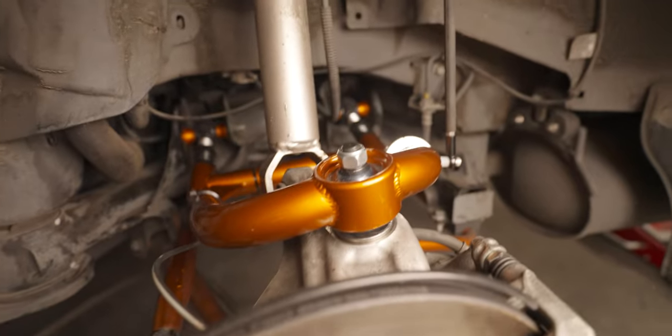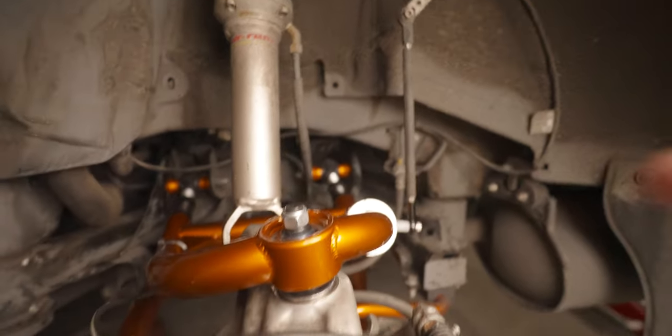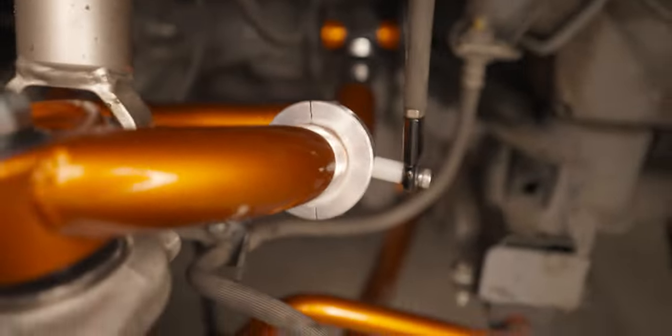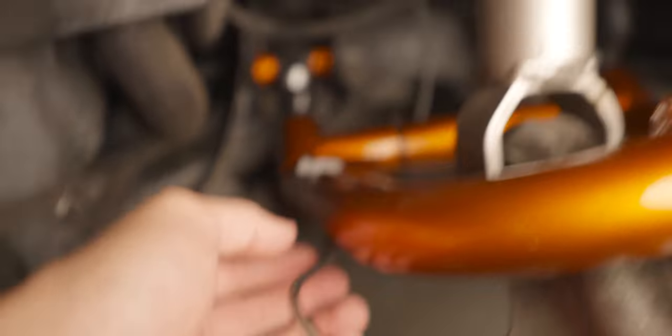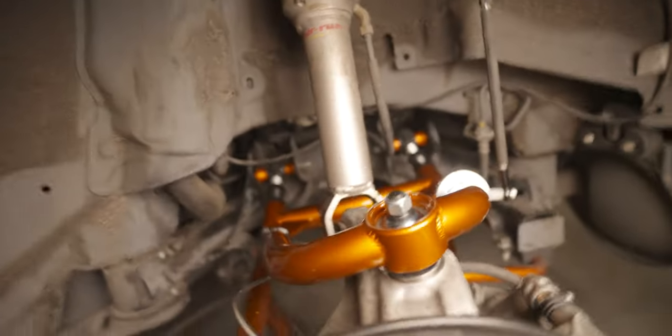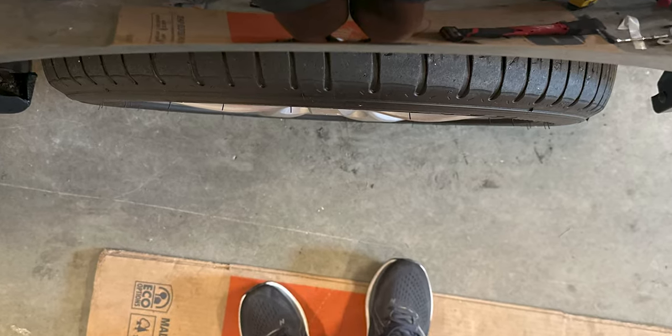So this is the final day of the install — day four. Lot of obstacles, mainly we just didn't have the tools we needed to complete the work efficiently. Yesterday I had to do things off camera, but I finally got things where I wanted. The ball joint issue is resolved and now seated. I installed the collar, connected it to the height sensor, tightened down the ball joint, and used zip ties for the speed sensor cable. After installing the upper arm, the wheels are toeing in, so we gotta take it to an alignment shop tomorrow. Hopefully they can figure out how to align it since it's fairly elaborate parts.